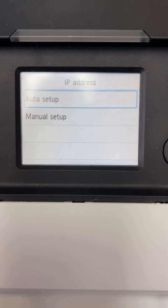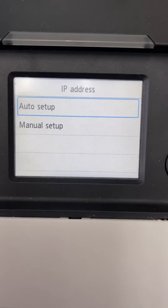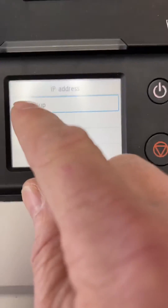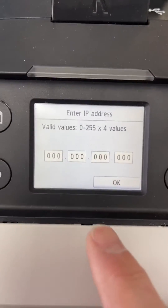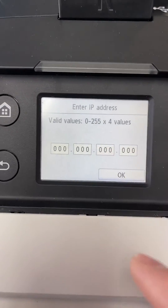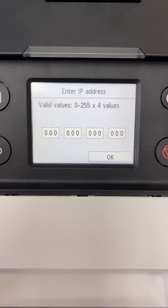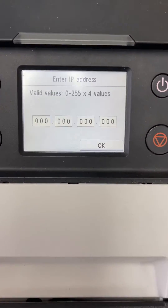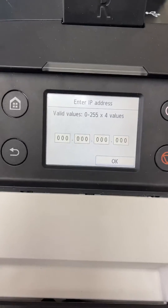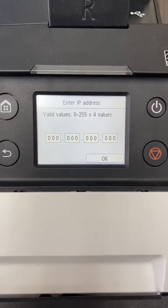It'll go and ask for an available IP address and set it. At that point, you will need to come back and then go into manual and add the one that it found in there manually so that it is now a static IP address. This will keep and eliminate, or at least reduce, connection errors anytime any network device is on a network, and printers especially, when you have fluctuations in power, they can lose the IP address.